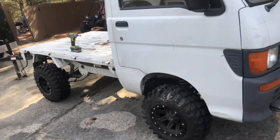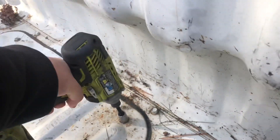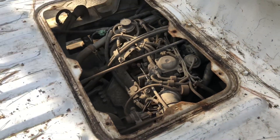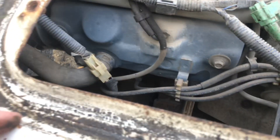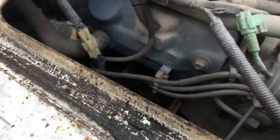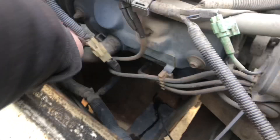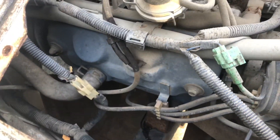We got her all pulled out of the parking spot and the first thing we're going to want to do is pull this back panel off. We have an engine and a carburetor, and it looks like what we're after is going to be on this side. Here is the valve cover. Looks like we have some spark plug wires tied onto there, some vacuum lines routed to it, and a couple wires. We're going to have to get all that out of the way and pop the valve cover off. I'm also going to make sure all these pine needles and dirt are cleared so none of it falls into the engine.